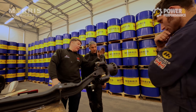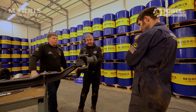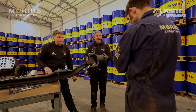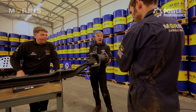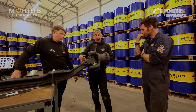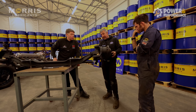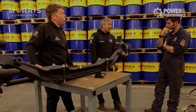When that's in the straight-ahead position, you can actually see the three degrees of negative in there now. It's so fine — if you just turn that ever so slightly and measure that, that's different. So when you're trying to bend that, we've had two days on it — two full days. One day we're like four of us around it, a full day. We do it and then it cools down and it moves the other way. Eventually Dave took it home, built it all up, put the hubs and everything on it. We made some bronze bushes in there. Once we tracked it up ready to install it, we realised it was wrong — it was like one and a half degrees off on one side.